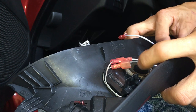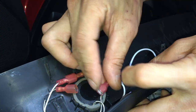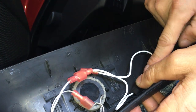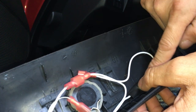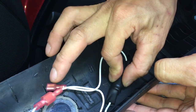Looking at the A-pillar and the seam, there's nothing in this area above the tweeter — there's actually enough space right there. I think I'm going to get some of the same double-sided tape and stick the component to the back side of the A-pillar cover right there.